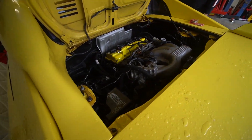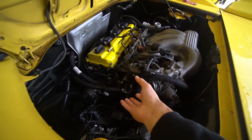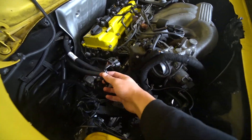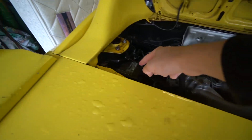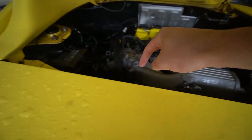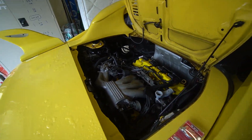Here's a better look at the engine sitting in the MR2 engine bay. It's a 1MZFE. We've got wires and stuff just chilling everywhere. We need to put an intake manifold on here, connect up some grounds, connect up the mass airflow sensor, some fuel lines, mount the fuel pressure regulator, get that coolant cap back on. We need to get the overflow pipe running all the way across — it goes all the way from here back all around there, so we need to make up some brackets. Some little vacuum lines we have bungs for, so we can just block them off because they're not needed. We also have to mount a polyurethane engine mount bushing because there's more torque in the V6 than in the 3SGE. With more torque there's more engine turning, so you need a stiff bit of polyurethane to hold that flex from ruining the stock engine mount. And we also have our Aeromotive fuel pressure regulator which we've never installed before.